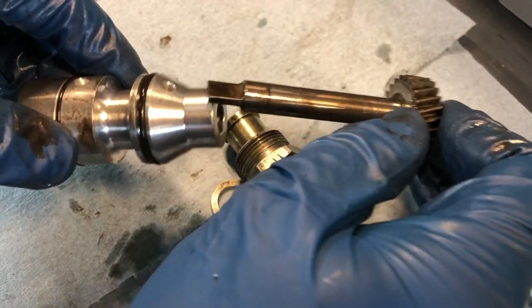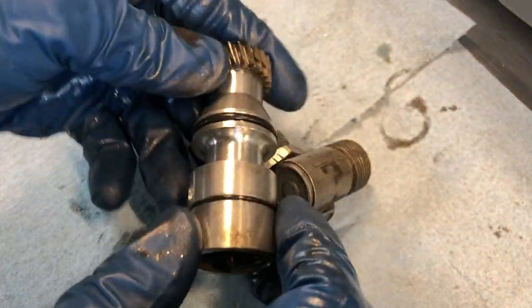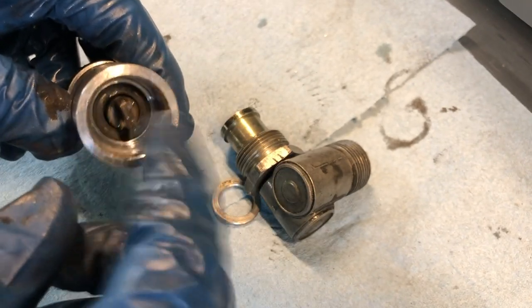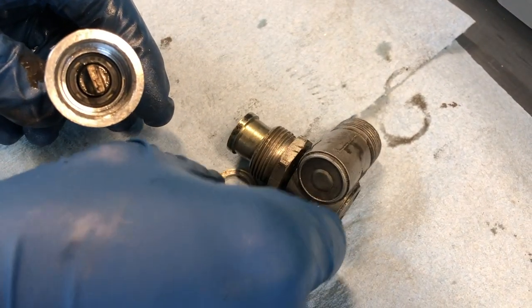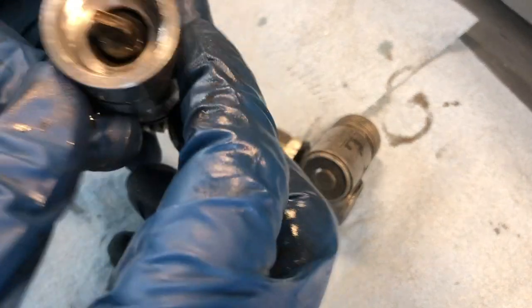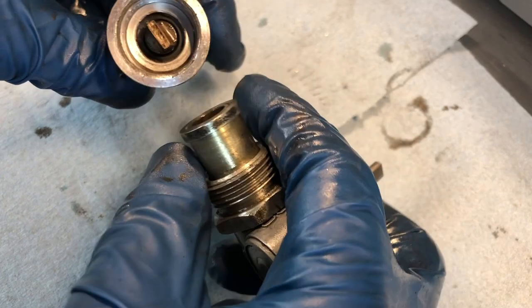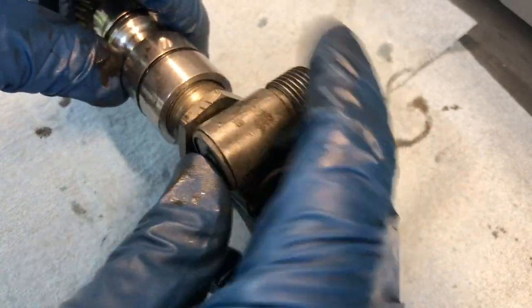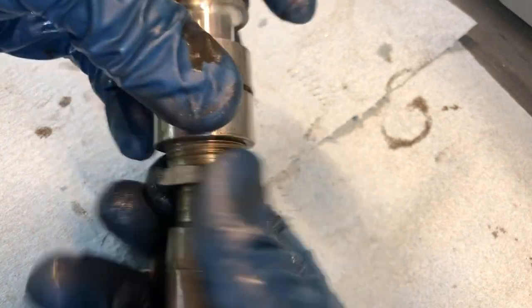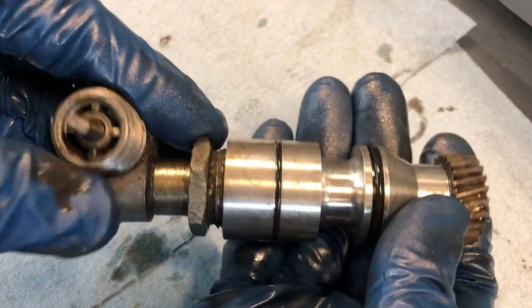For reassembly, take the drive gear and put it in through the top — it just snaps in, make sure it spins freely. There's still some gear oil on it which helps. Now take the sealing washer and drop that in. Next grab the angled part; I've already cleaned the mating surface. Make sure the slot lines up, put it in, and get the coupler started at least hand-tight until we get it on the car. Now you can see that it works — turn the gear and the cable part also turns.